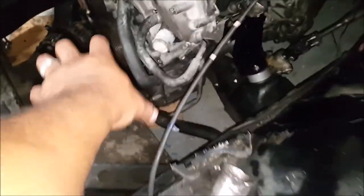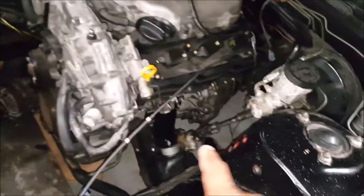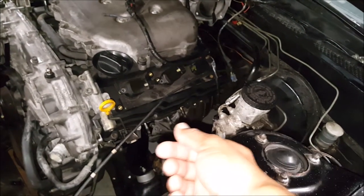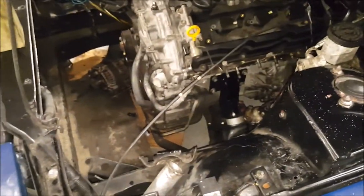So with the SOHO kit, my brother-in-law and I basically run the headers out the back, come back this way for the turbo, and have the turbo sit here — flange here, turbo facing that way, exhaust shooting straight back. Then to connect the passenger side to the driver side, just a pipe that comes along the back underneath the tranny, wherever I can get it to clear, then joins up and leads to the turbo. That's the plan.